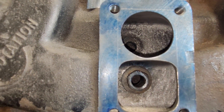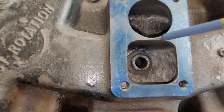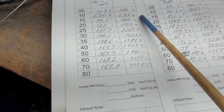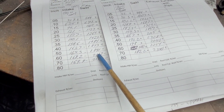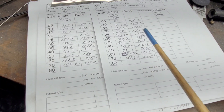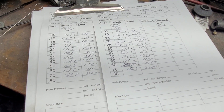Of course, I have to go through every single runner. But I haven't finished all the ports on the head yet, so that would take more time. I still may take this divider and machine it down. The swirl is up everywhere from the round plenum. I think even with this crummy manifold, we'll be able to get where we have to get.